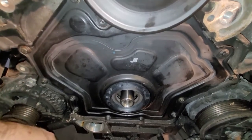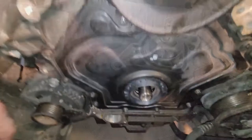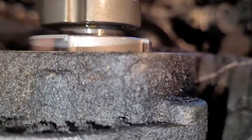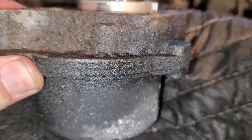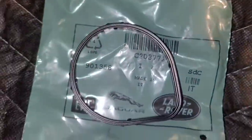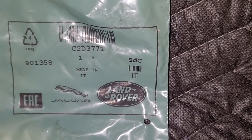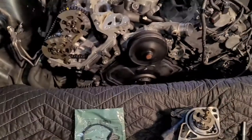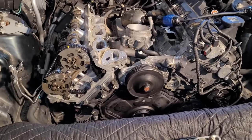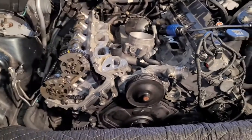So while we're down here and it's easy to see, I got a new seal for this vacuum pump. Let's put that on. Here is the vacuum pump. This seal is almost flat against the metal. You can see all this gum or grime here. The seal has been allowing some oil to leak out. So, got the new seal. Here it is. It's part C2D3771. For this whole job, I want to link most of the parts in the description down below. You can find links to them.